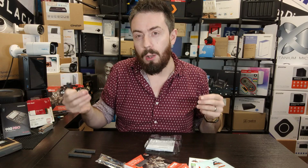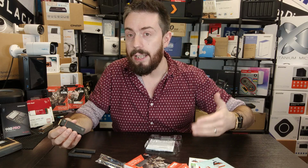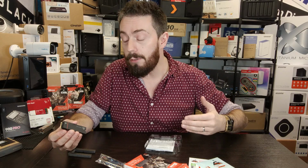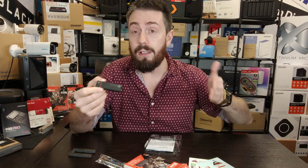It's their way of saying it will maintain that performance in that life cycle, but also bear in mind that it means that if a brand sees that you've exceeded that terabytes written before the end of those 5 years going by, the result is that they can effectively refuse your warranty. They don't have to support you. So when you're looking at a drive that has a much, much higher terabytes written rate and a much ultimately higher drive writes per day across the whole spectrum of capacity, it means that you're not going to get slightly shortchanged if you do a lot of write activity to the SSD, and therefore that exceeds the warranty years period. It also means that this drive will ultimately live longer in terms of sustained write and the effects on that durability.